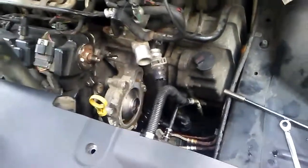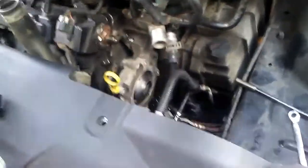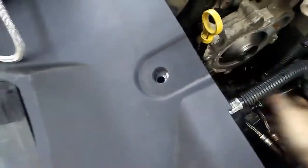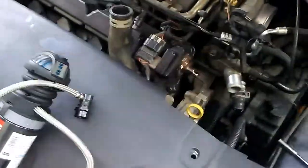I just found out they've changed this up. This is not like the traditional Northstar engine that I'm sure everybody is familiar with, where you take the tool, put it in here and get your water pump out of there. What they want you to do on this model is literally swap this whole pump.